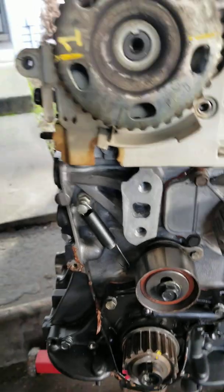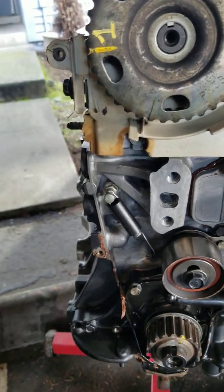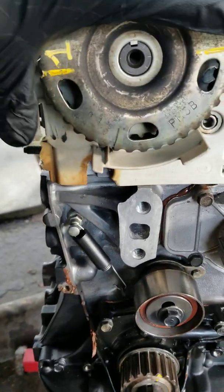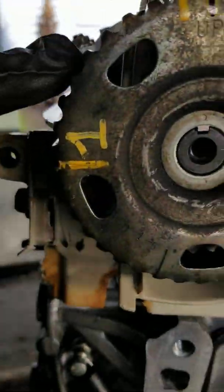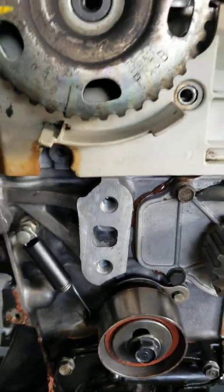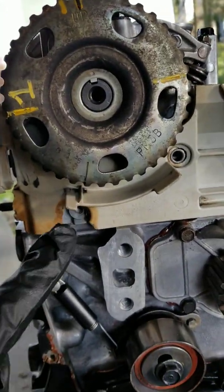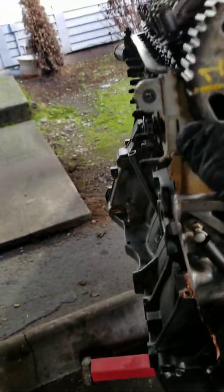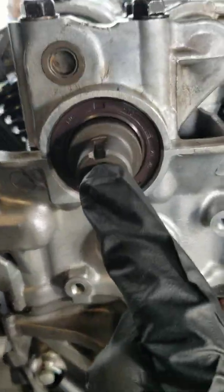How can I solve this problem? How can I make it happen when I have a D15 block with a D16 head? Nice and easy — I'll share it with you. You take the old pulley — the plastic one. Mine is sloppy because I don't want it there permanently, but it's there just for aligning purposes. I'm moving it to match these two lines. That's it. And then I take it out. The key is slightly off — 4.5 degrees, like everybody said. It is true.